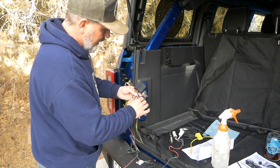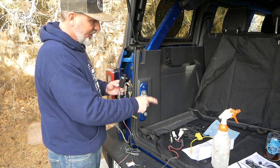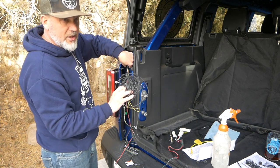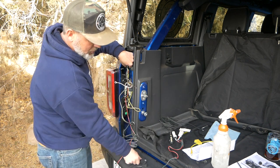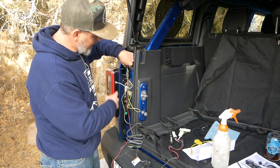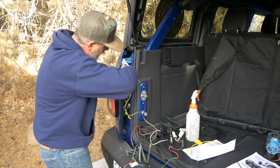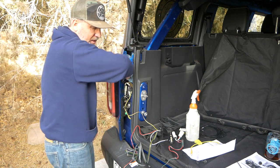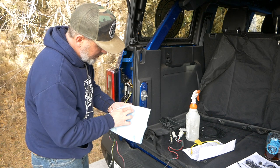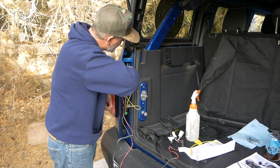Here's a good time to go through the rest of the harness. This is our power modulator right here — I'm actually going to mount this up inside. There's a flat spot on the body on the inside here and I'm just going to use the double-sided tape. I've got a power wire which is loose right now that will connect to the 14-gauge wire going to the front. Then you have your four-strand cable which goes to your connection to your trailer, and the red and green wire which will run underneath all the way over to the passenger side. I'm going to use a little bit of acetone and clean that spot off to keep the modulator out of the water for the most part. I stuck part of that sticky back on there and it wouldn't pull off — it basically just tore the foam, so I have no doubt that it's going to hold.